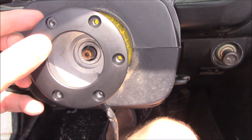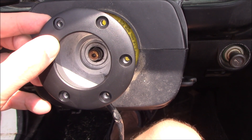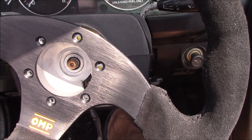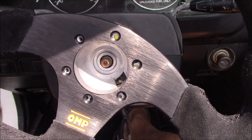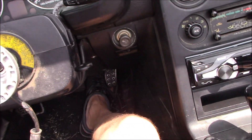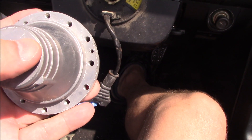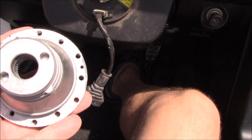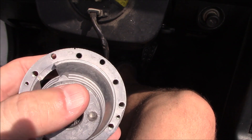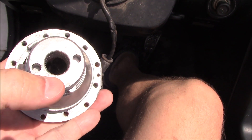I need to check that one of those screw holes is at the 12 o'clock position, not at 11 and 1 o'clock. Looking at the new wheel, if I go with the position of the nubs as they are, the wheel will be at a funny angle — which is not what we want. The fix is to pull this off and drill two new nub holes that correspond with the correct mounting holes I want to use.